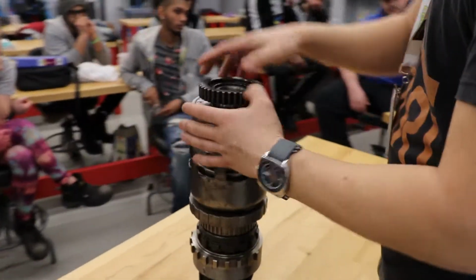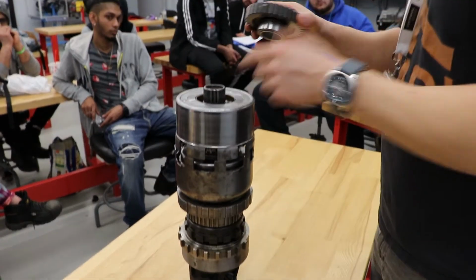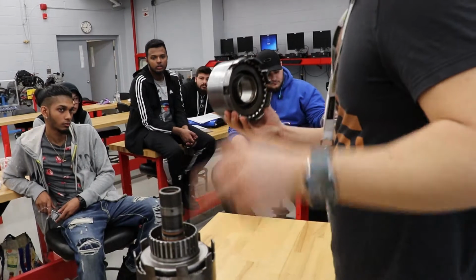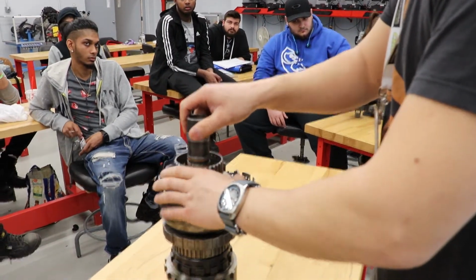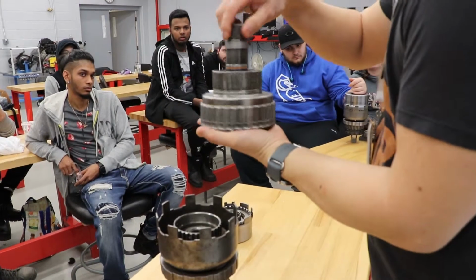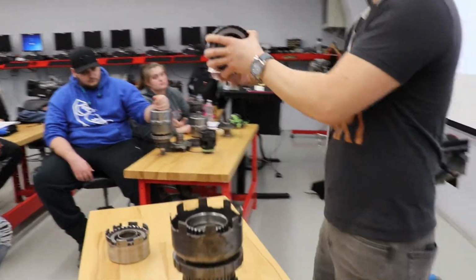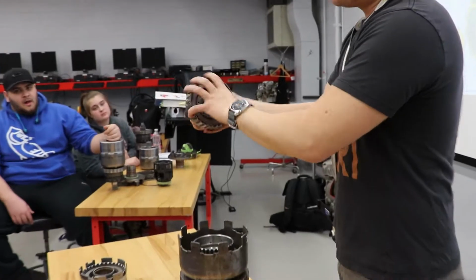So, torque comes in going clockwise relative to the engine, which will always be driving. This is splined to your forward clutch. As long as that sprocket is turning clockwise, it will be driving your forward clutch clockwise. Clockwise from the side of the engine, which is this side, not from this side, just to stress. Make sure you get in all these parts.